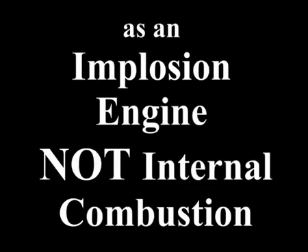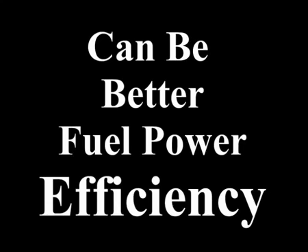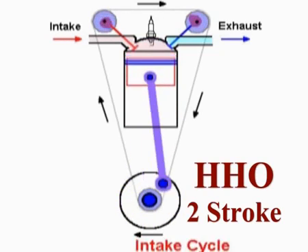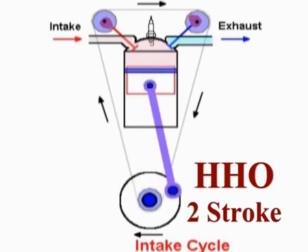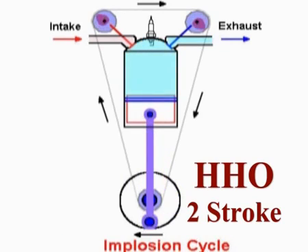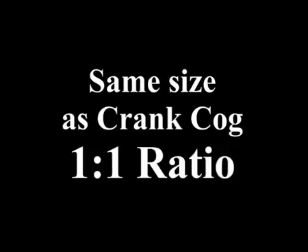Even if it was double — half a liter — we can do this far more power efficiently. Ideally we want to pass the gas in through fuel injection, as a carburetor is a completely different system. We do not want extra oxygen — we already have it with the gas. Fuel injection itself mixes air with oxygen; we do not want that. We just want to spray the brown gas in. Here we have the modified design where the camshaft cogs are changed to be smaller — half the size — so that the camshaft rotates at the same speed as the crankshaft.